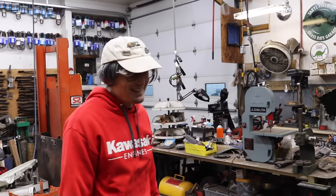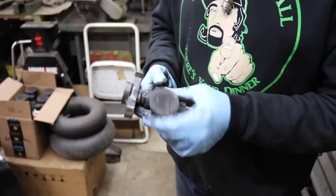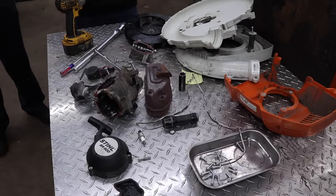Maybe like 15%? No, like 90%. You're right, 99%. Well, there you have it. This is what happens when you don't use the right lubricants on this Stihl four-mix stuff. In my opinion, it's garbage — some of their products, especially these big four-mix blowers — forcing you to use their lubricant in order to make this thing work and run properly. So if you've got one of these blowers and you're using cheap oil, you might want to run down to your Stihl dealer and get that four-mix oil before you do damage like this, which is going to cost you, as Ronnie says, a lot of money. Don't make the mistake that I did thinking you can just run whatever oil in there. There's a reason why they want you to use that four-mix — it's got special chemicals in there to help lubricate so this doesn't happen.